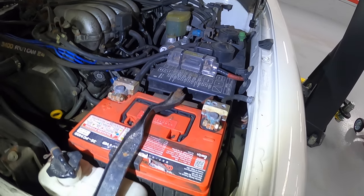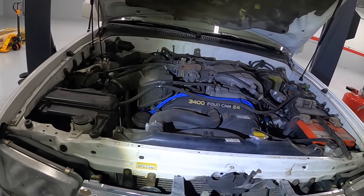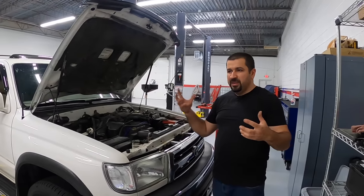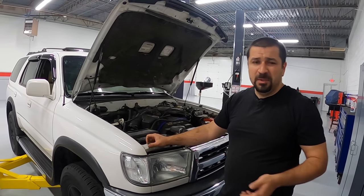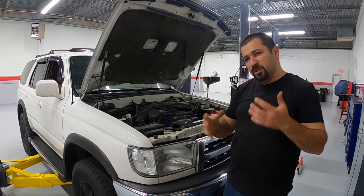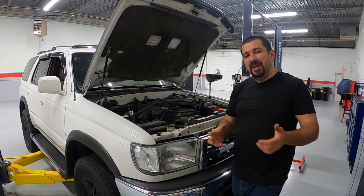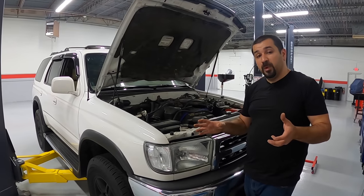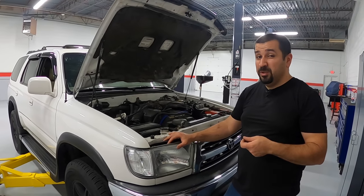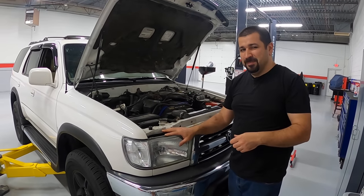Otherwise these things are solid. I know this sounds like a big list, but the majority is caused by rust. This engine is a very good engine. The timing belt is not really difficult to replace — it's very simple, similar to the V6, unlike the V8. Everything else is simple on these trucks. They'll have issues here and there as they get older, but they're not chronic — unless you buy a rusty one. Before we wrap up, a few more things I skipped: something somewhat common, especially in the 90s ones, are the front upper and lower ball joints — they will go at some point. Toyota did have a campaign to replace them. If that campaign applied to your car and you see it in the service history, don't worry because you have the updated ball joints. But if you don't, replace them.